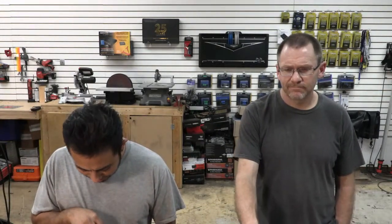Do I need to use a bass processor with a Pioneer 490, or does it have it built in? A bass processor? It doesn't have an Epicenter. It has a subwoofer control, and it has bass boost, which is a really generic version of bass restoration. But if you want something that is actually bass restoration, then you're gonna want an Epicenter. Oh, and an amplifier if you don't have an amplifier for the subwoofer.